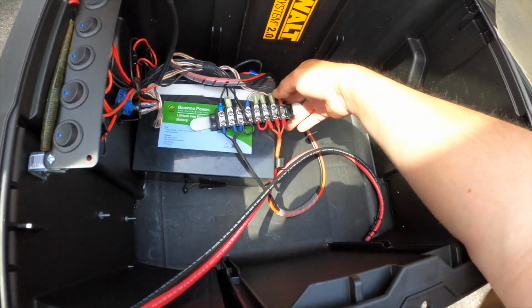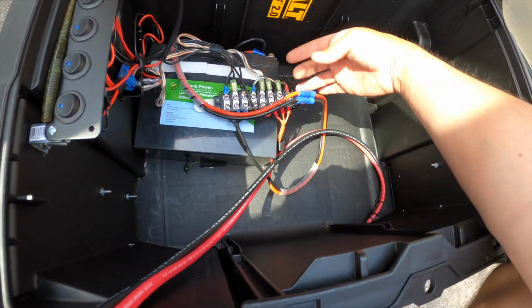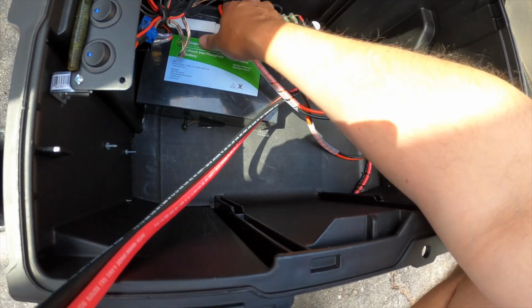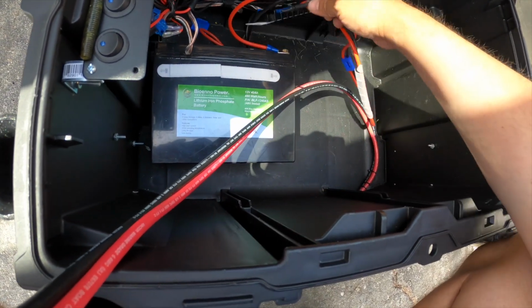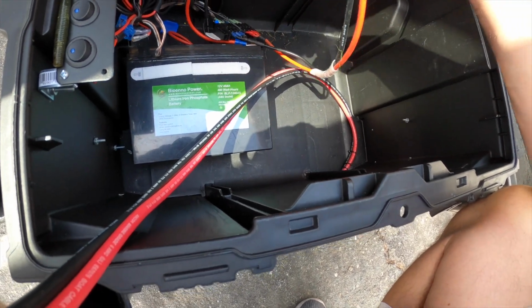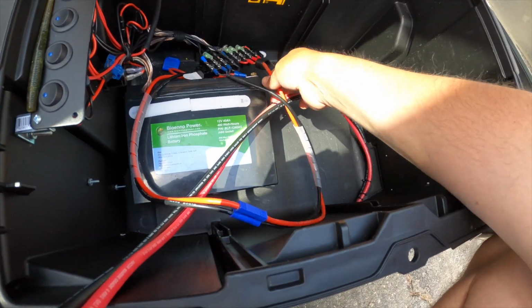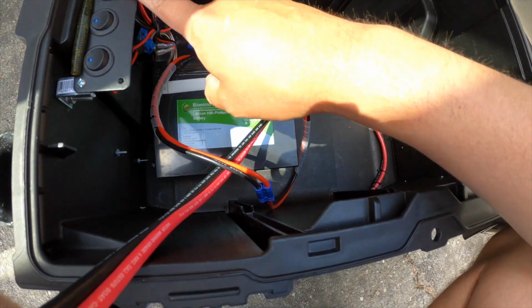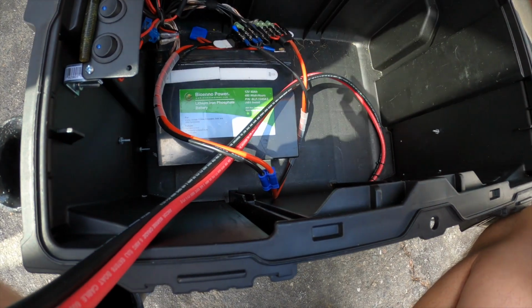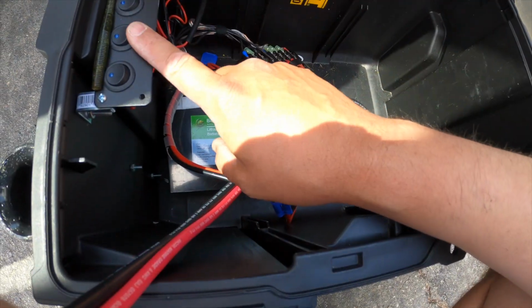Just to give you an idea, I've got my distribution block here. These cables right here run directly, look, I found my clip, these cables here run directly for strictly generating the power from the distribution block to the relay switch that powers on everything from the trolling motor, auxiliary, lights, and pretty soon it's going to be a 360 light.